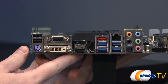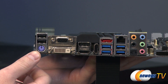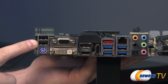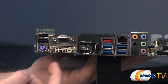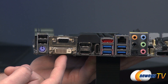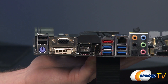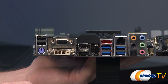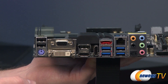Let's finish off with the I/O at the back of the board. First off, you've got a PS/2 connector for a keyboard. You also have a couple USB 2.0 ports — another great place to plug in a mouse or keyboard. Your video connectors are located right here: you have DVI-D, that's digital only; an analog 15-pin D-sub for analog VGA connection; HDMI; and DisplayPort. The HDMI and DisplayPort are capable of 4K output at 24Hz. If you're going for 60Hz, you can do up to 2560 by 1600.